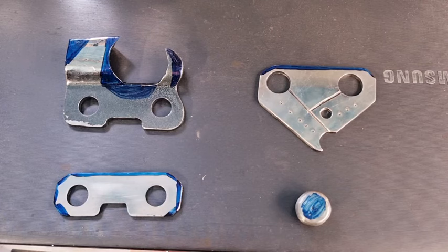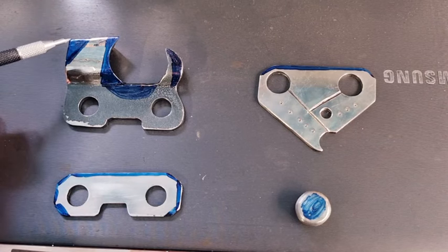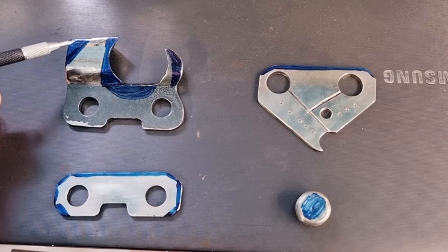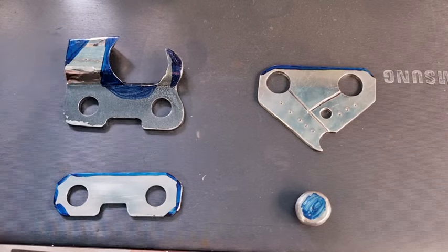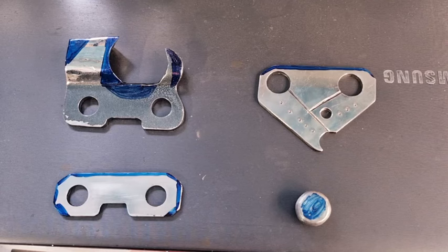On a racing chain, they remove quite a lot. Number one: they remove the back metal off the tooth. That's one part where they want to reduce weight. They also want to remove as much metal as possible so that they can get rid of the chips much quicker, because some of these chains are spinning much, much faster than a standard chain. They need to get rid of the chips properly and efficiently.